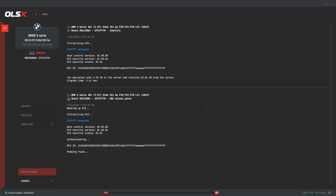Make sure you have any updates disabled and you let the dealership know that you do not want any updates. If your DME gets locked again, you will have to go through this process again. Sometimes after an unlock, your tuner will still not recognize that the DME has been unlocked — if this happens, you can force flash the DME and you will have no issue after that. Our DME unlocks also do not include a tune; you must flash the tune on your own. We simply allow the DME to accept tunes.